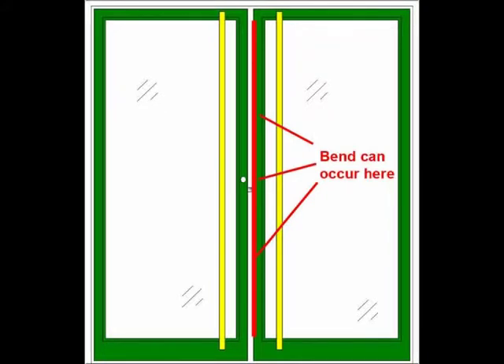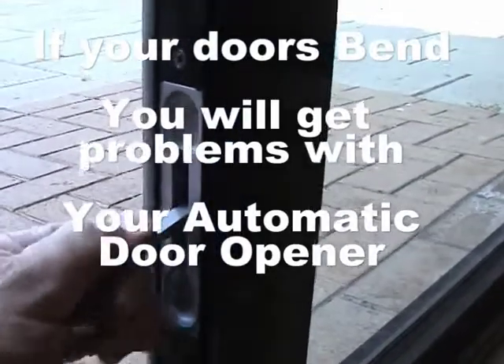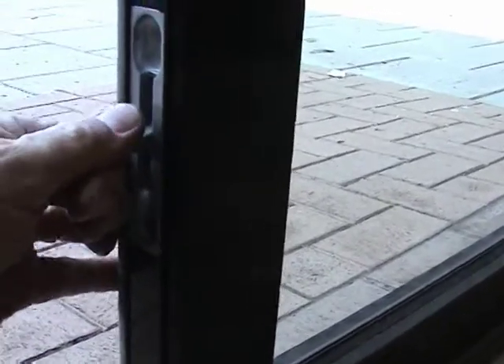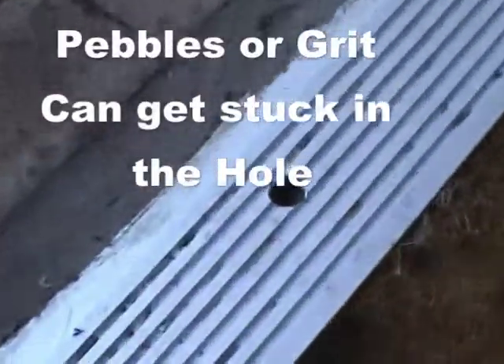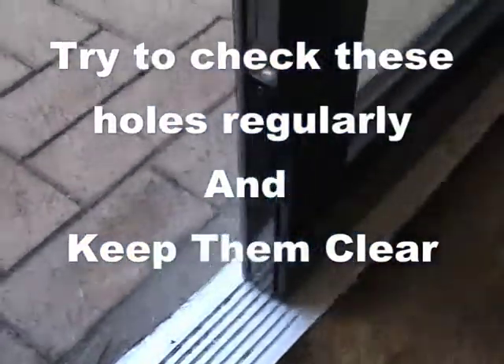Now I want to talk about why the bolts don't get put down — it's not necessarily your fault but there are a couple of things you need to know. Sometimes the bolts do get jammed; they get full of road grease and grime. Also, where the bolt goes into the floor you can get some blockage in the hole. This one is jammed solid and won't move. The hole it goes into can get filled up with pebbles, debris, dust, or greasy grimy stuff, and that can literally cause a problem and stop you being able to put that bolt down.